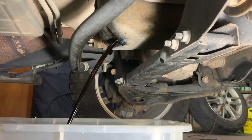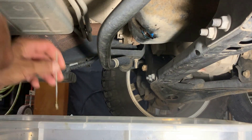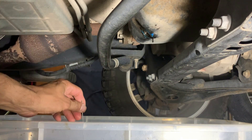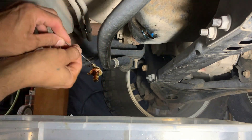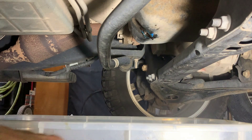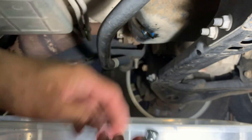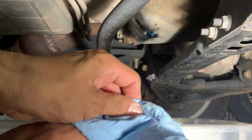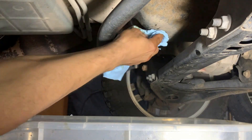I'll show you so you know I'm not kidding. While that drains, I'm going to fish out the drain plug with the magnet — I can see it right there. Okay, what you want to do is inspect the drain plug. Make sure this washer is on there — it looks good, very good on this one. They can be plastic, aluminum, black, white, different colors depending on your vehicle. Then you want to make sure you clean the area and make sure there's no debris that's going to prevent you from getting a good seal.